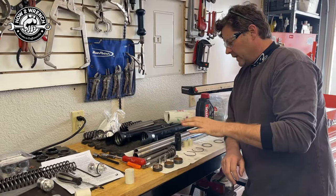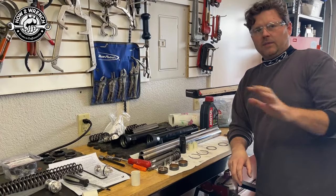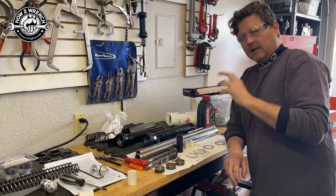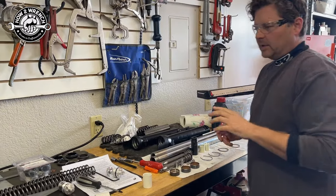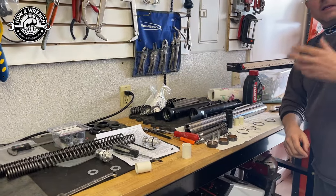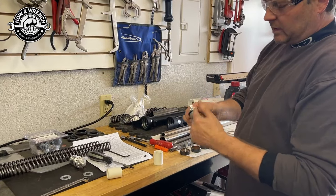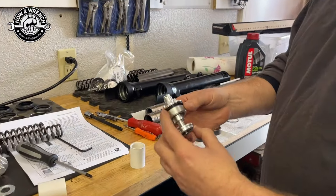When you're doing suspension, it's a great place to improve the bike. People want to throw exhaust on and make them loud — I say spend money on suspension. You're going to make the bike so much more enjoyable to ride. So we've come up with a couple of things: we're putting a pair of progressive springs in here, setting the bike up for his weight, putting some performance oil in, and the other really cool thing on this Triumph is an external preload adjuster accessory.